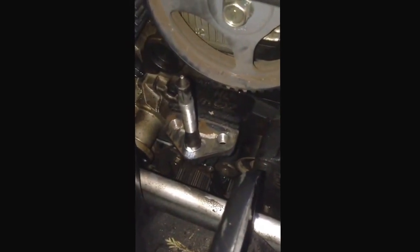I realized I need to take this engine mount out to get the timing belt off. If your timing belt is in good condition you don't have to take it off, but mine was missing teeth, so I'm going to go ahead and replace it. It's recommended that you replace all these belts anyway since you're spending the time to get up in here.